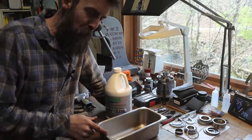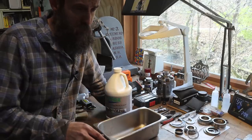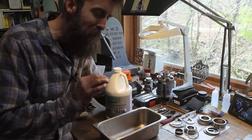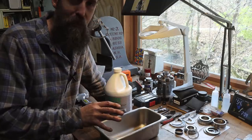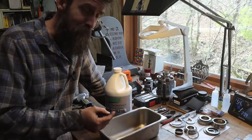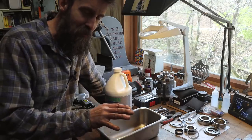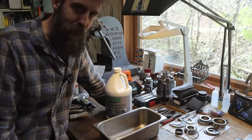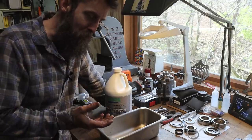So the passenger side floorboard on my truck was almost Flintstone style, really rusted, super thin, I mean just paper thin. You would have just breathed on it hard and it would have broken through. Didn't look bad from the bottom, but from the top it was really rusty. So we just cut it out altogether. There was no rust treating that side. It was just so thin, there was nothing we could do other than replace it.